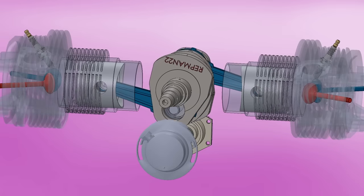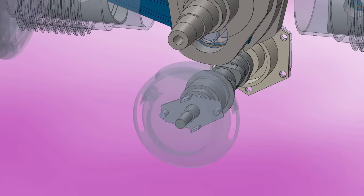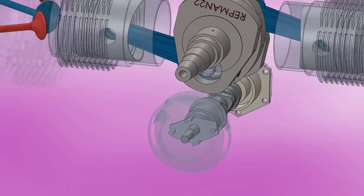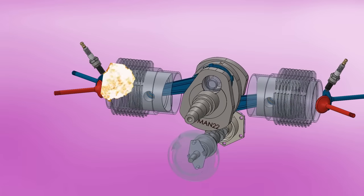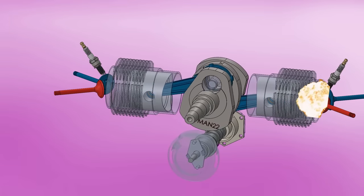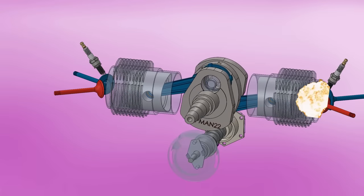There is no conventional distributor. The spark is commanded by a rotor with centrifugal advance on the camshaft at the front. This means that every time a piston reaches TDC, the coil fires a spark in both cylinders regardless of whether it is the right time — in other words, the spark plug has twice the wear and therefore lasts half as long. This was done to save cost by not placing a distributor. Its name is the wasted spark system.